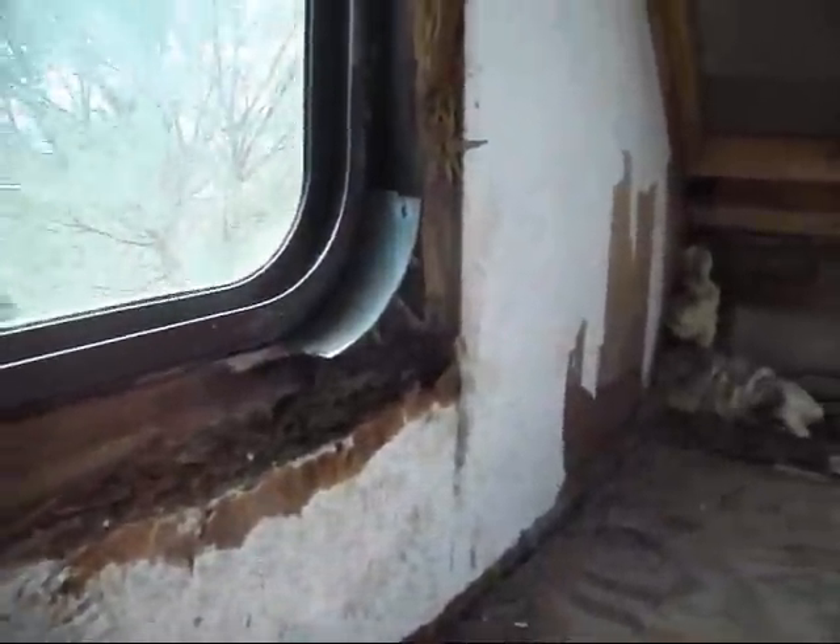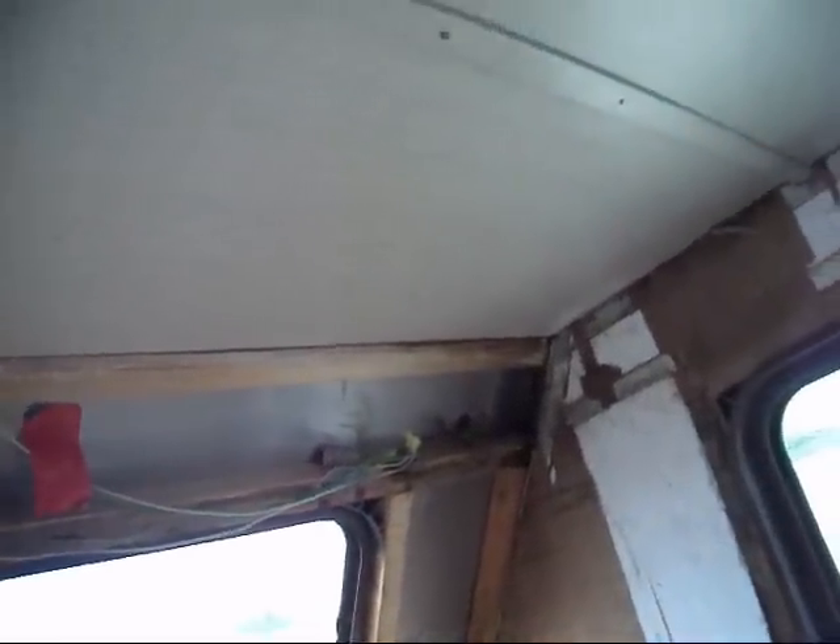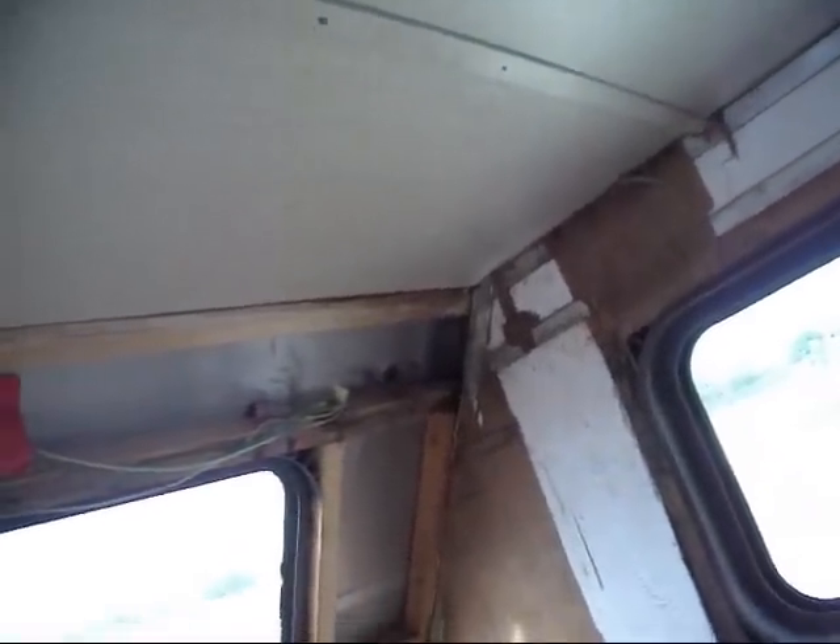As I get this all stripped out, I'm going to kill everything before I put it back together. This is the other window frame — you can see the rot. I've pretty much determined that our problem started with these windows not being sealed, and also these marker lights up here. You can see that marker light right above it — so that was leaking. We're going to seal all of those and redo the roof, make sure everything is tight and right before we put it back together.